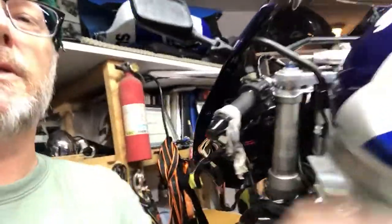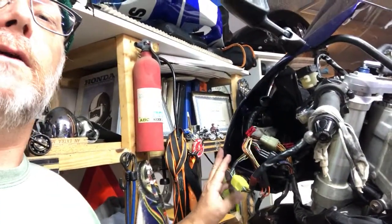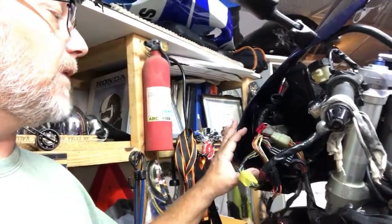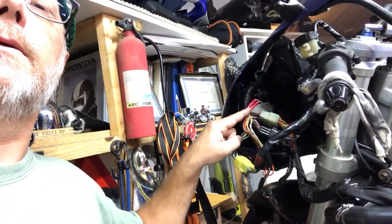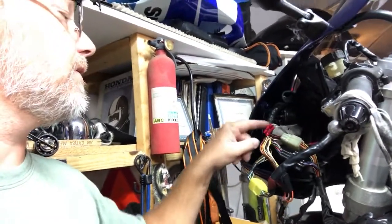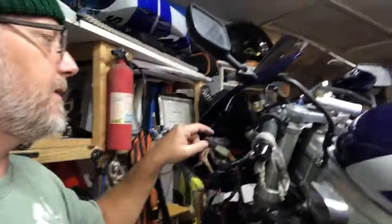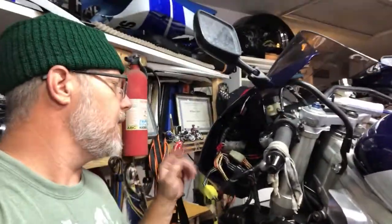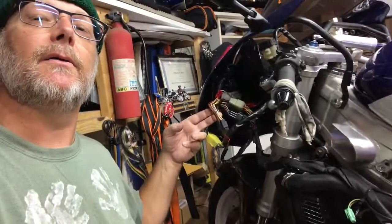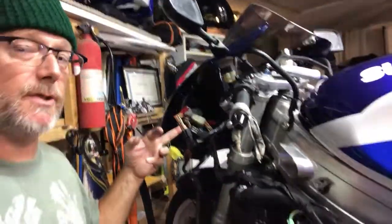harness on this machine. And what we found is, I did some research online, and this front left fairing, there's this wire bundle up in here. And what I found was somebody's been in here. Somebody has cut out the quick connector for the turn signals and done one of those shaved turn signal kits. They wired it up using the wrong product. But anyway, this is the wire bundle right here that controls the start stop button and the starter, the run stop switch, and the starter button.